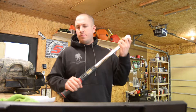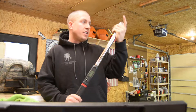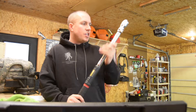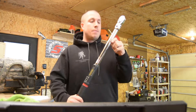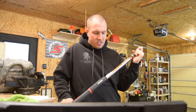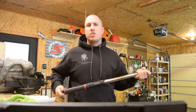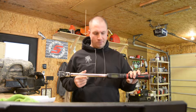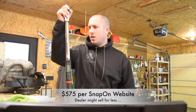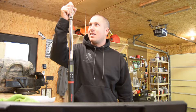Now some people are particular about calibration. In the military, of course, we sent in our torque wrenches every year to get calibrated even if they didn't need it, and some would even say if you dropped it, it needed recalibration. I don't think you need to recalibrate a torque wrench every year. When you drop it, I can see how that can screw things up, but otherwise I would probably send this in every five years. It does cost money to get Snap-on to recertify it, so you put the money into it every five years. If you're a hobbyist, not a big deal — not a bad investment. I think it cost me around $525.